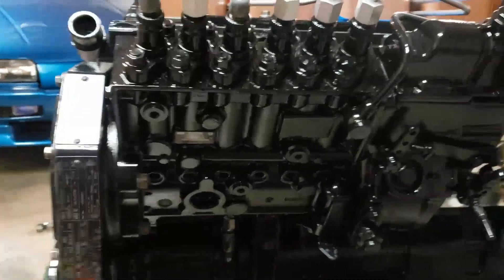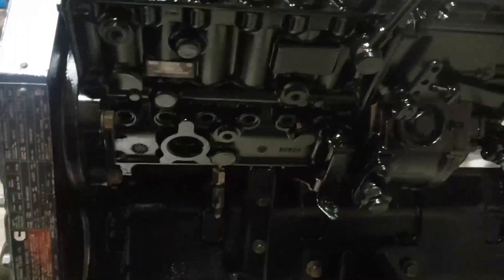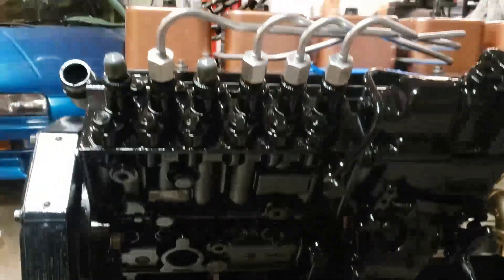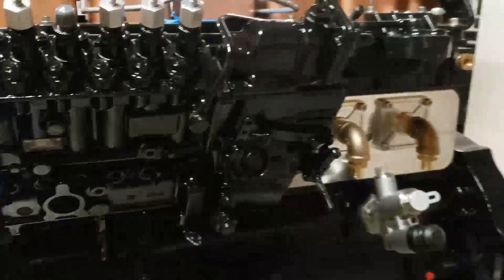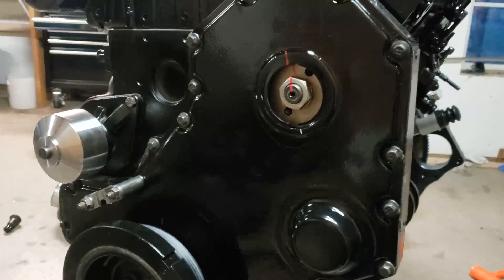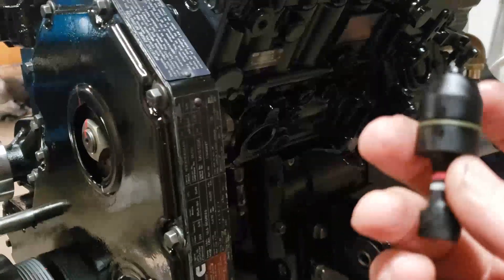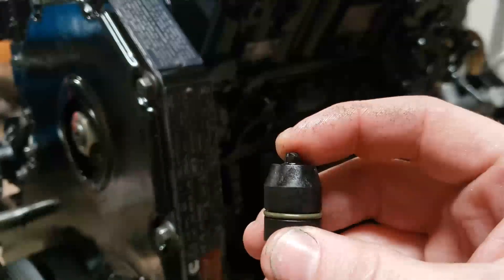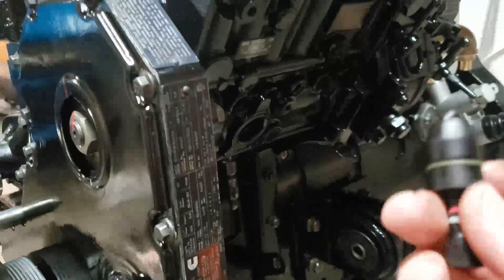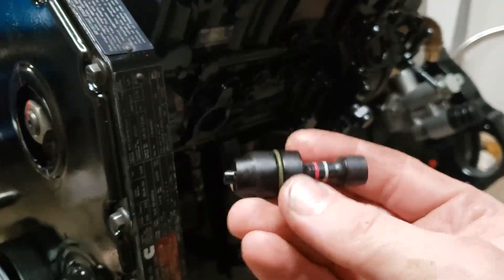None of that seems really complicated, right? You put the pin in there, you've got a pin in here, simple. The problem I ran into — and granted, I've worked on a couple of these but not done a whole lot to them, this has been a complete rebuild from the ground up — one of the problems was initially trying to get my motor at top dead center, I snapped that pin. I literally snapped the end of this off right inside the camshaft sprocket. I was spinning the motor too fast, even doing it by hand, and that was enough force to break the pin off. I got a second one, made the exact same mistake, thought I was going slow enough, and still ran into the same problem.